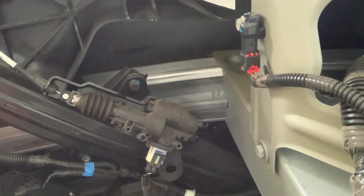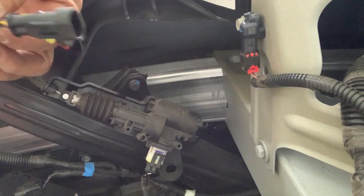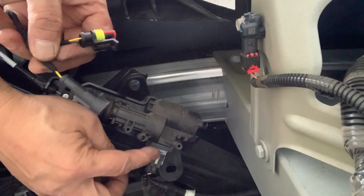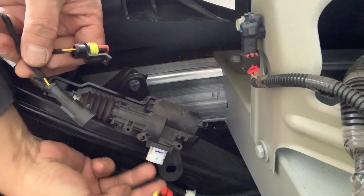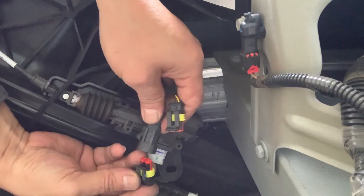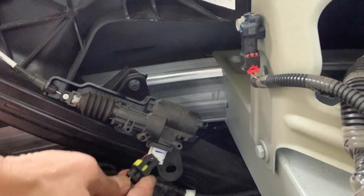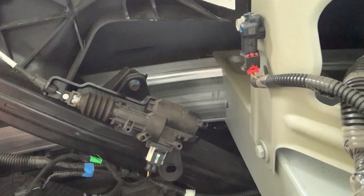Next thing is another bypass — also labeled 'motor plug.' We're gonna bypass this connector here. When you're facing the car from the front, it's on your left side. Unlock that, plug this onto the connector — which in this case is this one — and then plug this where you took off the other one, right there.